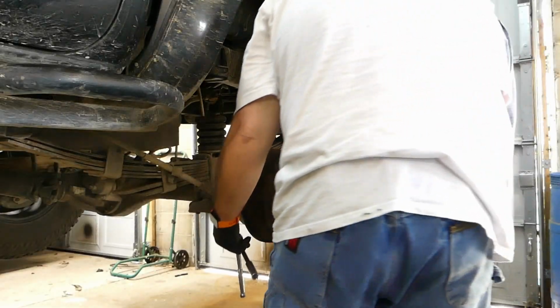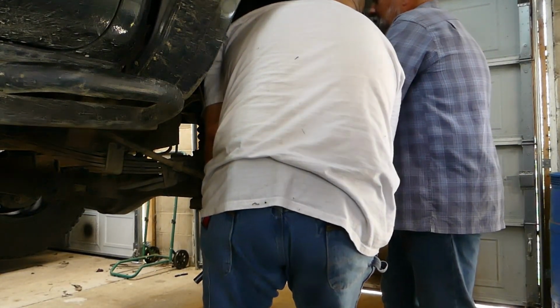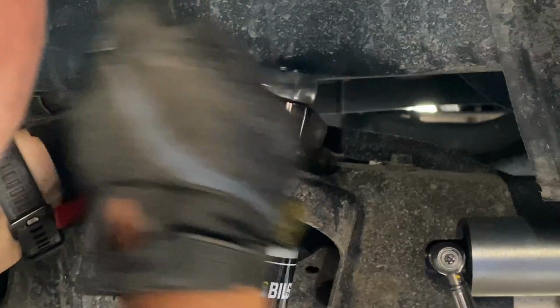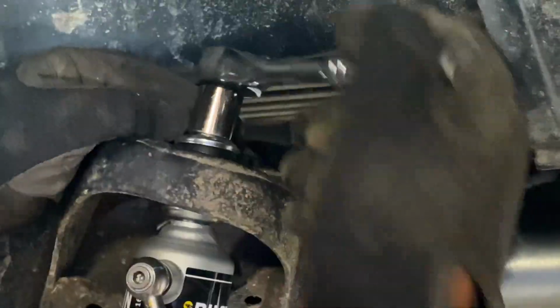Lift up on your axle, because it's got my shock extended as far as it'll go. Snug. I'm done on the bottom. Clear on the bottom. Then you've got to get the squish right on the bushings. The way I learned it was you squish them until they're just a little wider than your washer. They pooch just a little wider than your washer.